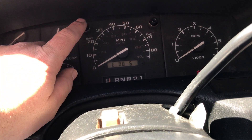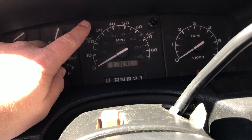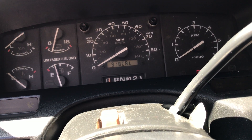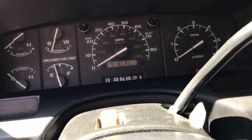If you hit the reset button one time, it will display your current conversion constant. In this case, the vehicle is calibrated to 9.18, which should match up with the factory tires since the conversion constant has never been changed.